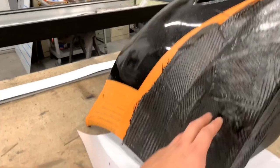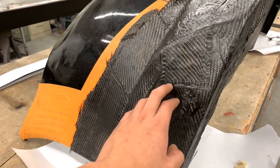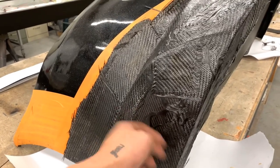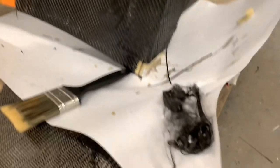When you're applying the carbon fiber and resin, the edges of the carbon fiber fabric can start threading — you're going to get strands pulling out that will harden on your surface. So if you can, try using fuller or slightly larger pieces.